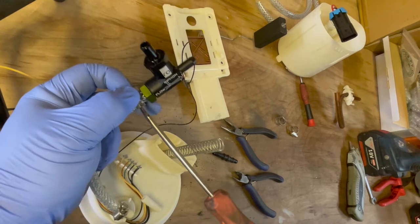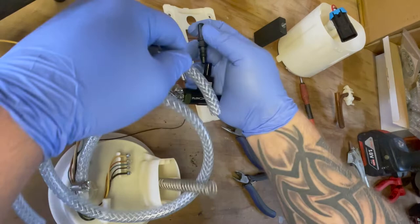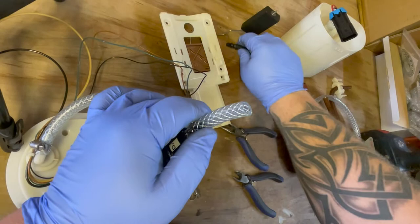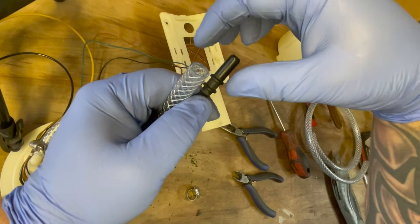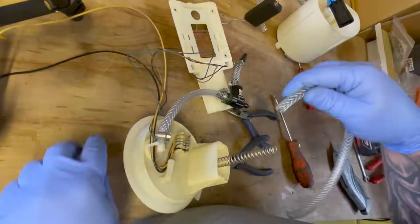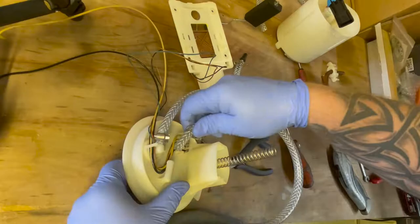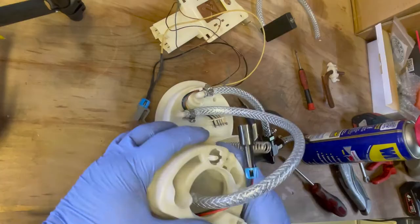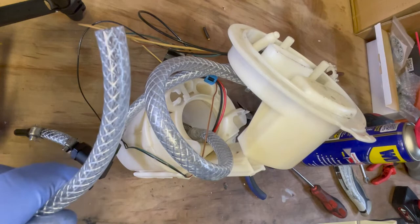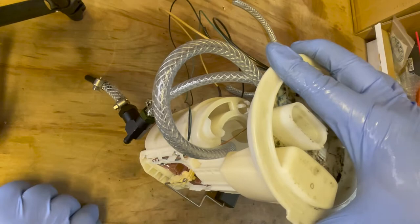I'm just going to get a section of hose for this piece. This is 8mm diameter hose, by the way. This is the piece that fits into the clip with the two red buttons, and this is the side that fits into the original fuel hose. Stick that in there and connect to the existing line. I just need to chop a small section — this end needs to be semi under the fuel level at the bottom of the tank, so I'll cut it flush to the bottom.